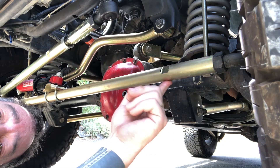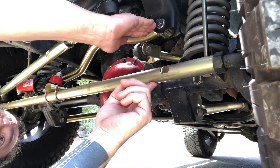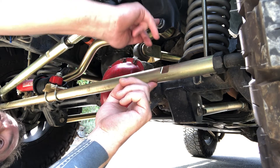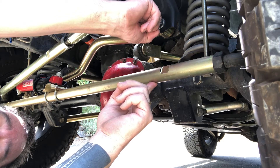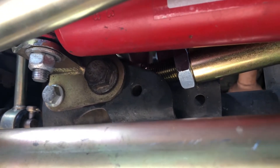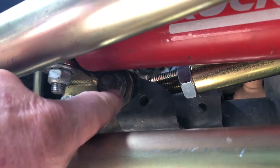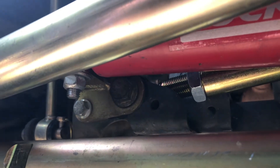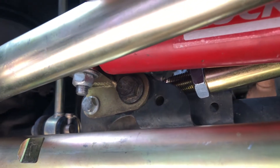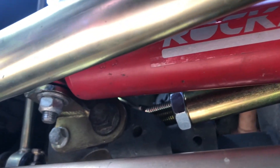This is where your death wobble comes from 99% of the time — I know you guys know what death wobble is. So it's bolted there on the frame side — it attaches to your frame. Nice fit; everything just fit really nicely in there. Cleaned it up a little bit, that side's done, torqued it down. The axle side — it's kind of hard to see — bolts up right in here. That flag that I was talking about is back in here, this little box. That's the bolt right there, still 21 millimeters. Torqued that down pretty tight. Let it dry for a couple days and then go in and re-tighten it again. Tighten up the jam nut there. Sorry about the quality of video — I'm laying down on my back upside down, so it's kind of hard to see. But that's where she mounts up.